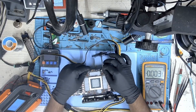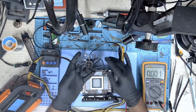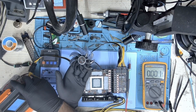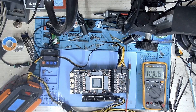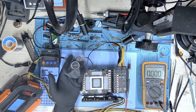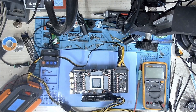I have a new fan to test with. Let me connect it and test. The fan is working in the first slot, so that slot is fine. Let's connect it to the other slot — it works there as well. So the connectors are okay, there's no problem on the PCB. The problem must be with the fans connected to the cooler.